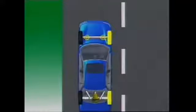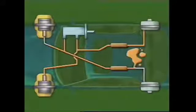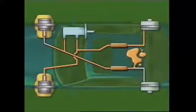During braking, on any type of drive, if braking effort is greater on one side of the vehicle than the other, positive scrub radius will cause the vehicle to veer towards the side with the greater effort. Negative scrub radius will cause the vehicle to veer away from the side of greatest effort. How much it veers depends on the size of the scrub radius. This is why vehicles with a diagonal split brake system have negative scrub radius built into the steering geometry — if one half of the brake system fails, the vehicle will tend to pull up in a straight line. Since the offset of the wheel rim determines where the centre line of the tyre meets the road surface, it is important that the offset is not changed if wheels are being replaced. Changing the rim offset changes the scrub radius and also the predictability of vehicle handling if brakes should fail.